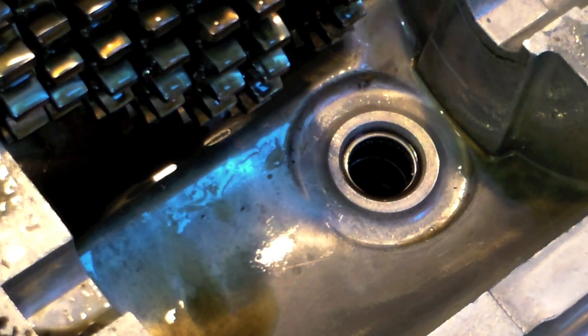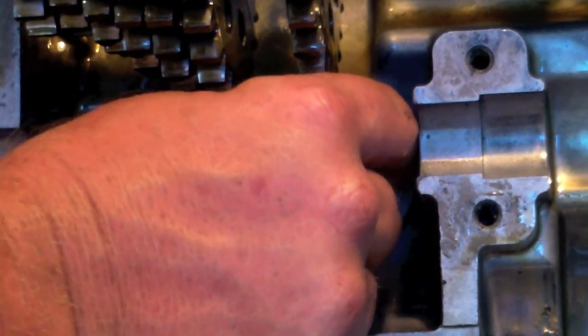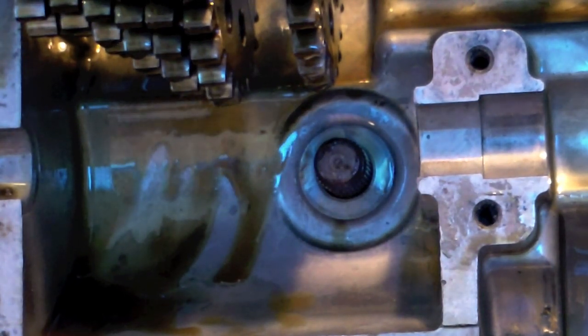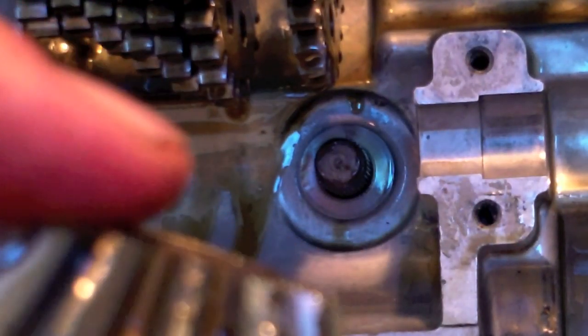I have a little bit of silicone junk inside the bottom of the pan, and we'll fish around in there in just a minute. But we're going to go ahead and place this double pulley on there, and then put the pinion input gear on. Okay guys, now more to come. O-ring, put it back on the way it came off, and you will have a lot less problems. Washer, and then the gear. Woo, almost dropped it. You can see teeth are kind of boogered up in one or two places.